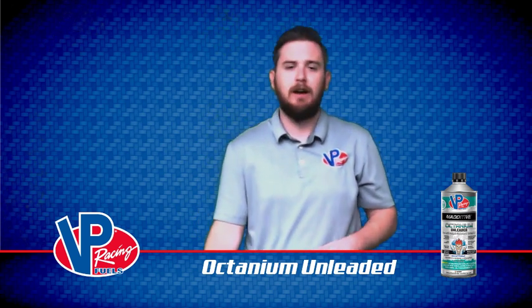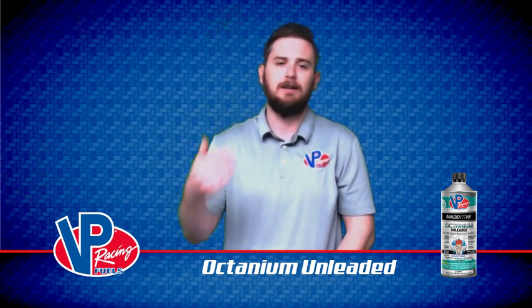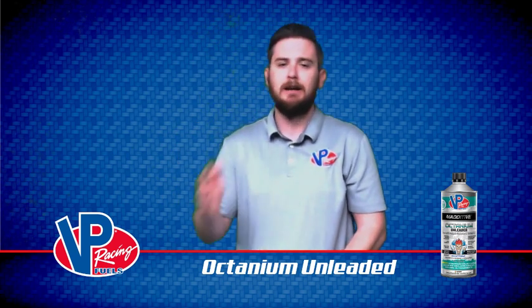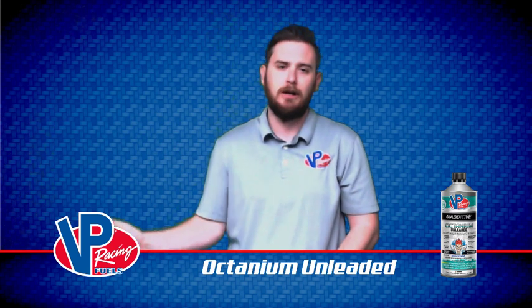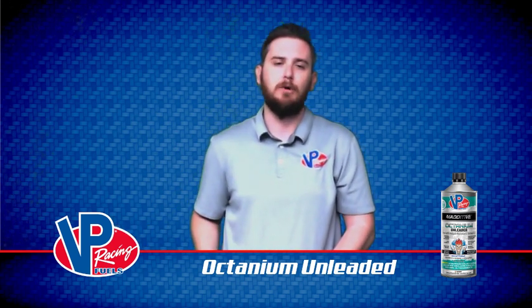So that is a huge value proposition to your customer, especially in the late model audience where you have catalytic converters and O2 sensors, but you're also looking to bump it to a 100 octane tune. That way, when you play around on the weekends, you can keep a case of this in the trunk. And when you're at the track, you can dose it and basically have a race fuel concentrate here.